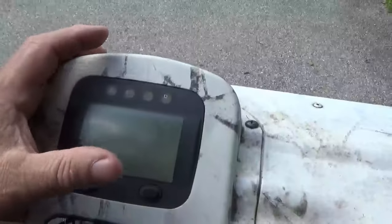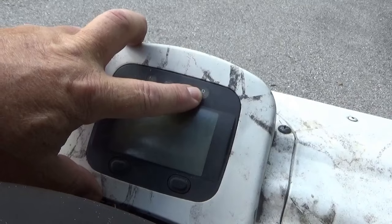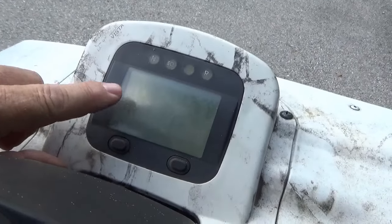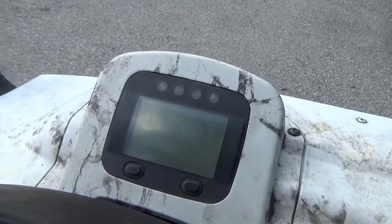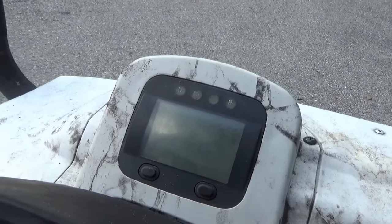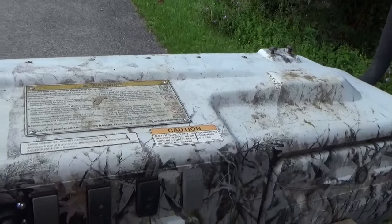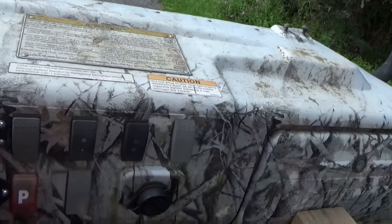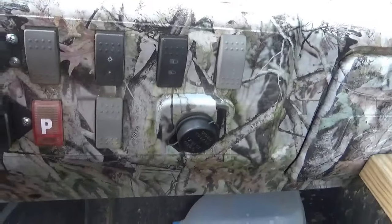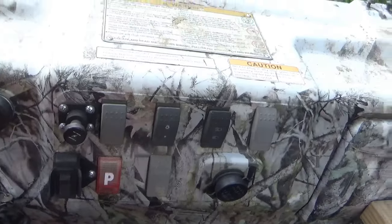This dashboard makes it so that everything is still alive. I can see when it's in neutral — that'll be green — and it'll go yellow when I pop it into reverse. I'm able to see speed, gas gauge, RPMs, and all that. I could have just hacked it so the CDI runs on a pit-bike model — that does work for this, by the way — but that kills all the dashboard function, and I didn't want to do that. I want the dashboard functioning. These switches are alive, so you can put it in reverse and turn all that other stuff on and off.